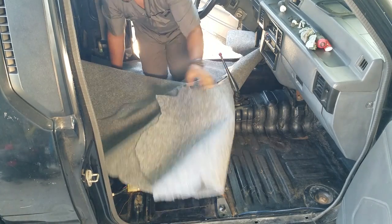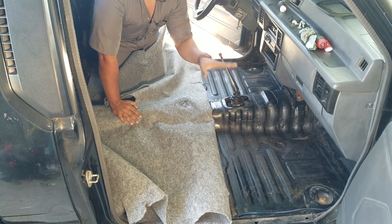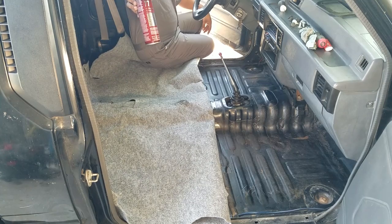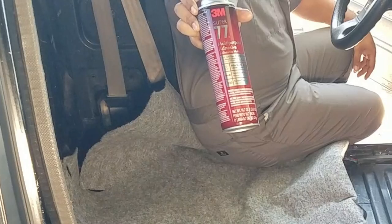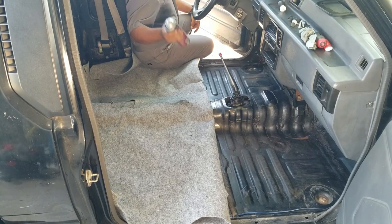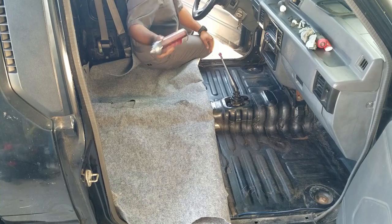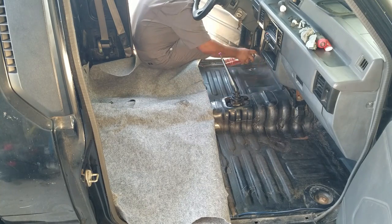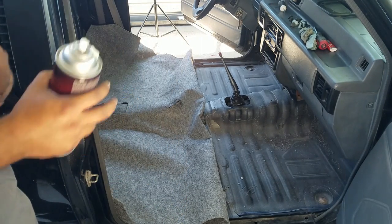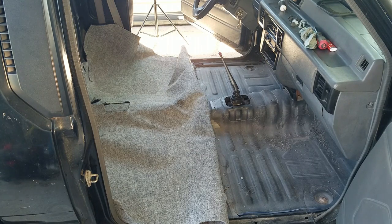Let's lay the carpet back and start with the front half first — that's the part I want to look better and adhere better. Lay the carpet, fold it in half like so. I'll be using the 3M Super 77 adhesive. Line up the nozzle. In the areas where I don't want too much adhesive — like where the wires, plugs, and bolts on the floor are — I'll go light. Everything else gets a nice heavy coat. I'll let it dry for a bit and throw a light coat on the bottom of the carpet as well. Give it a couple seconds to get tacky and then we'll put it in place.